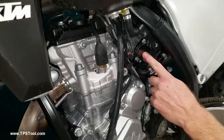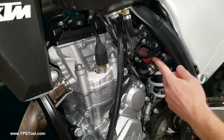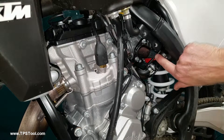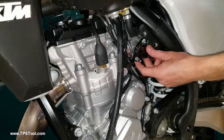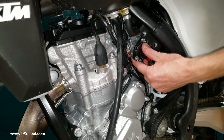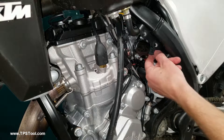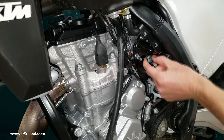So now what you have here is a throttle position sensor, and this blue plug right here is the plug you need to remove — that's the one we're going to work with. Remove this plug and that's where we're going to plug in. To make it easier, we're going to straighten the throttle body back out again — grab both sides and gently twist it. Now grab a hold of this tab with your thumb and the plug pulls right out. That's our plug.